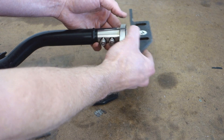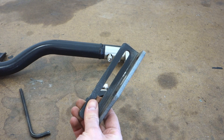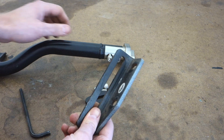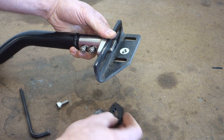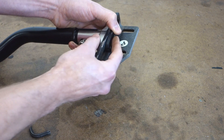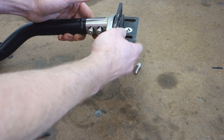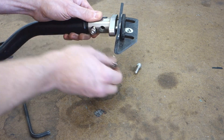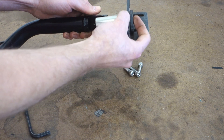With this, you can put your engine as forward or as back as you want, as long as it's within this range. Most engine mounts give you about an inch forward or back from the stock position, and I'm fairly certain these brackets would accommodate all of those combinations. This goes on here, and then this piece caps that — it goes over that machined-out piece as well. Then you put your Allen bolts in from this side and they go through and hold that in place. Once this is bolted to your subframe and all this is attached, you don't have to take it off to drop your transmission — you just take out these two Allen bolts and this stays in the car while that comes down.